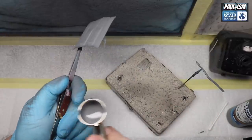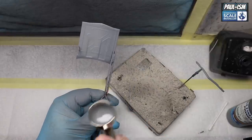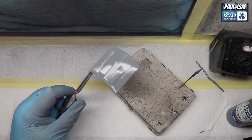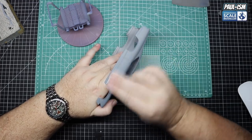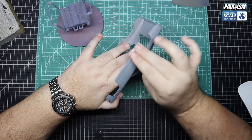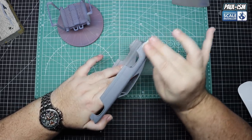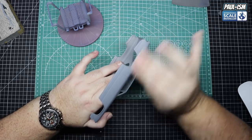When you're doing your bonnet, make sure you get the edges as well. Underneath, some will be painted black so it's not a worry to get it all. Set that aside overnight. The next day we're back - we've got some 8000 micro mesh and we're just going to go over and lightly flat all the primer. Being aware of all the edges and corners - we don't want to burn through. What we're doing is taking off any high spots and any dust, just to give us the ultimate flat finish for our paint which we're going to do next.